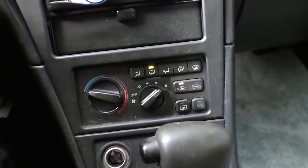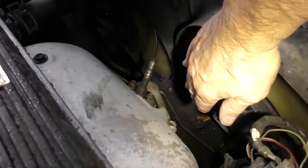In the summer, make sure your cooling fans are working right. Turn the AC on full blast and full speed, then check the cooling fans. Over the years I've had many customers have one or both fans stop working. The insidious thing is if one doesn't work and the other does, the temperature gauge might stay pretty much normal on your dash, but you're not getting correct air flow. Make sure both fans are working correctly, especially in stop-and-go traffic.